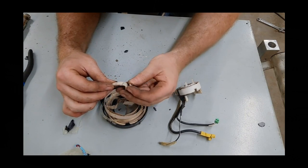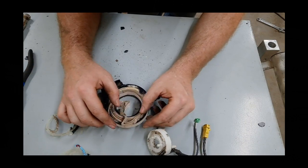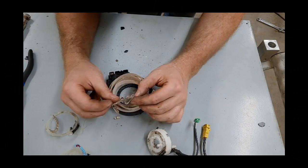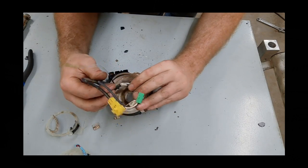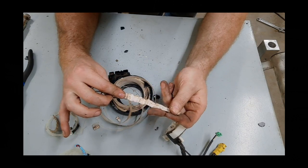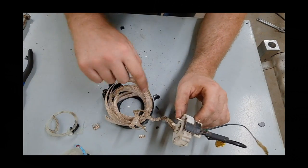I think we can see what must have happened. When I took the steering wheel off there were a lot of little white pieces underneath, and that's actually pieces of this ribbon that had flaked off. With age, you can see how much dirt is in there from years of use. Up here where it was supposed to be connected to the center piece so it could pass all the wires back and forth, it just disintegrated and came apart. In a couple of places it has broken — probably typical for older clock springs. Essentially it's just a ribbon wrapped up inside that is connected to the connectors and the center piece, and as you turn, the ribbon just tightens and loosens.